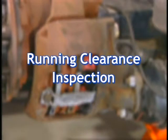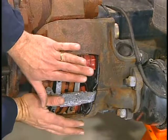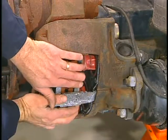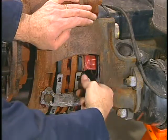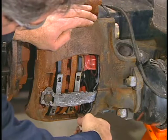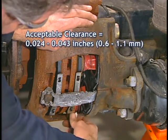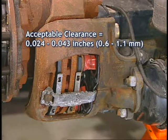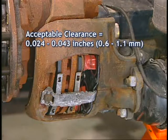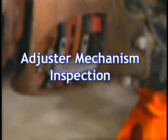Another regular inspection of a vehicle's air disc brakes is to check the running clearance. This is done by pushing the caliper assembly inward while holding the inboard pad toward the rotor and checking the running clearance between the inner pad back plate and each tappet. The clearance should be within 24 and 43 thousandths of an inch. If it is not within these limits, your next step is to confirm whether the adjuster mechanism is functioning properly.